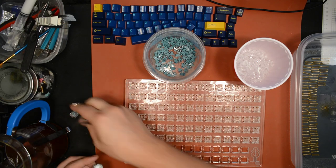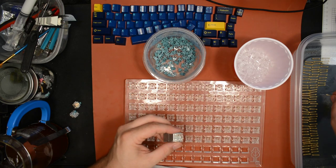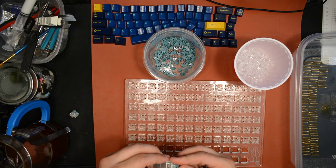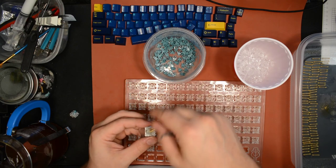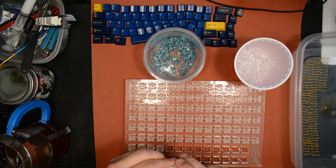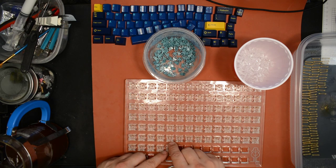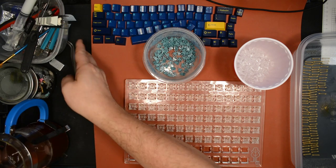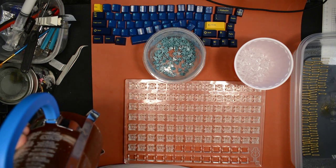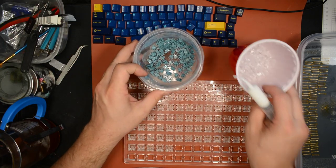So, if you're really obsessed with the sound of your switches, like a lot of people in the hobby are, you really should lube your leaves the way that I lubed them. You should do something to mass load them, meaning something to add mass that clings to the part so that it's harder for it to resonate and ring like a bell. I already showed you that it makes a difference and gets rid of that sound, so I'm going to go ahead and do that on all these switches.